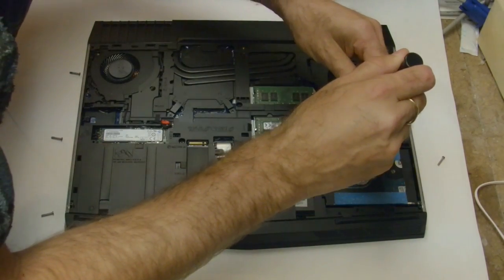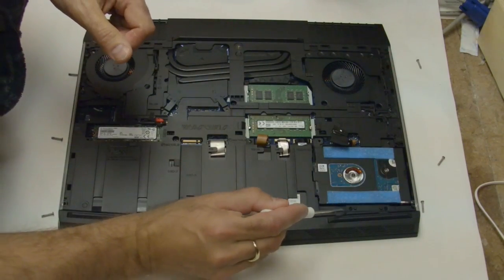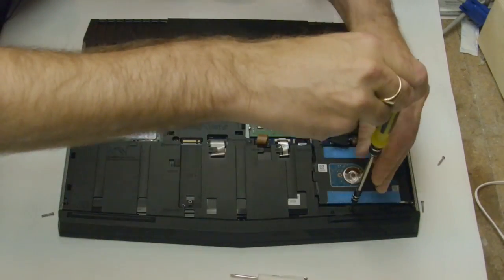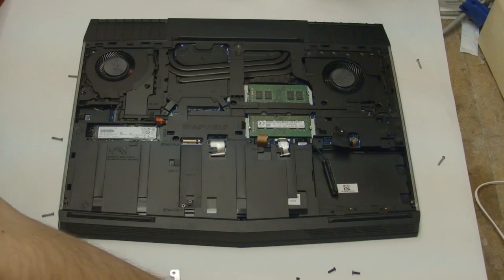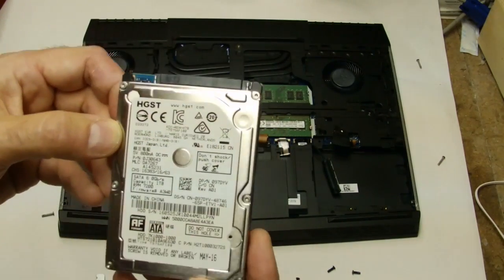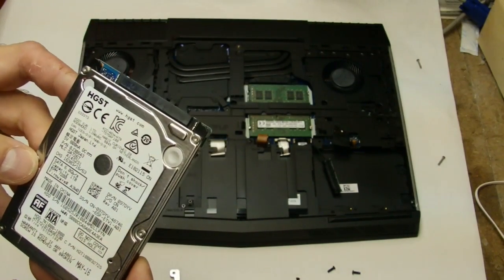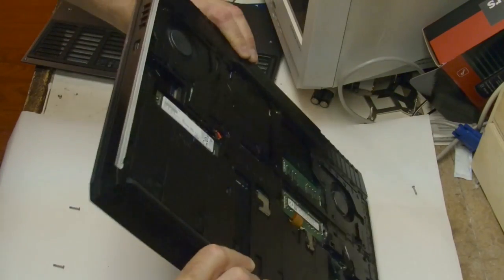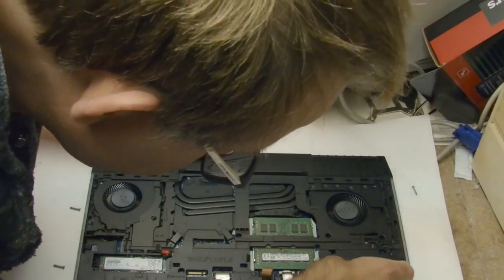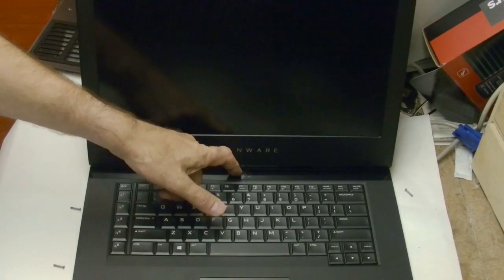Let's take the regular hard drive out. First, remove the battery cable as normal, then remove the hard drive. There's a screw here, here, and here that you have to undo — that keeps the caddy in. There's the hard drive removed. It's an HGST hard drive — not the most well-known brand, and I have to admit it is slow. Reconnect the battery and we'll see if it boots using the cloned drive.